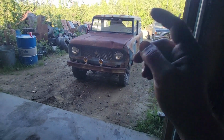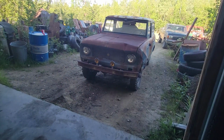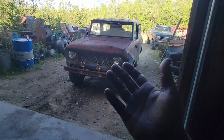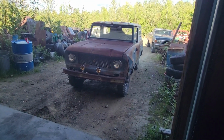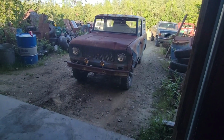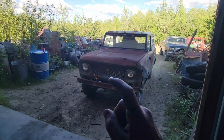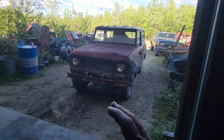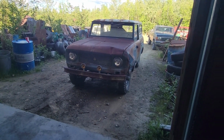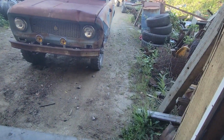I ended up chiseling it out, and then I got it cleaned up, and frankly, there's a lot of RTV around the outer perimeter of the new seal so that hopefully it doesn't leak. I'm not proud of that, but just the way she goes sometimes. Huge shame that that happened, but it's back together now. Of course, like I said, I left the front drive shaft out of there. I have to do the front axle pinion seal in the future, so there's just no point in putting the front drive shaft back in. And, well, it's summertime, so I don't need the pinion seal.